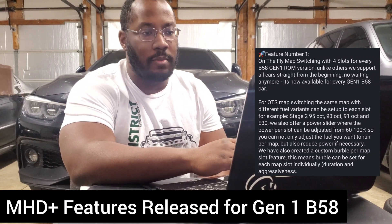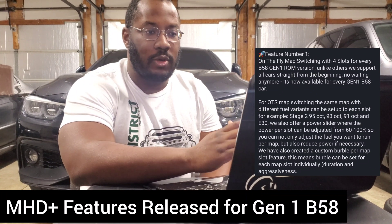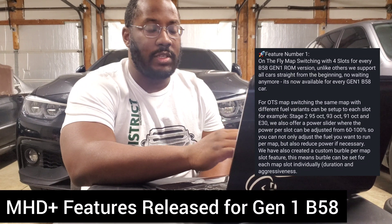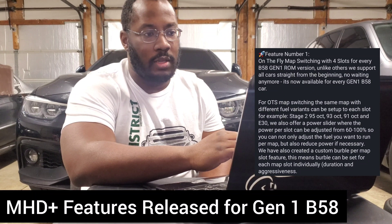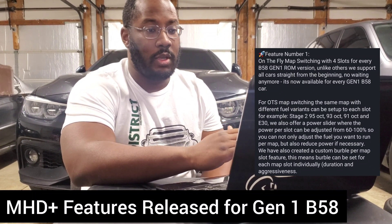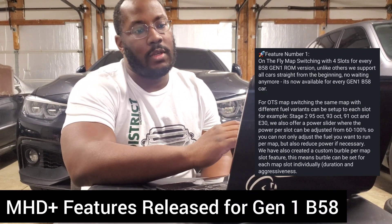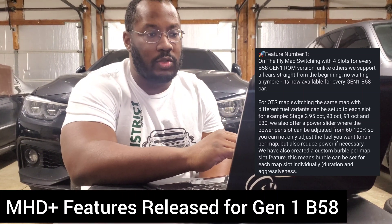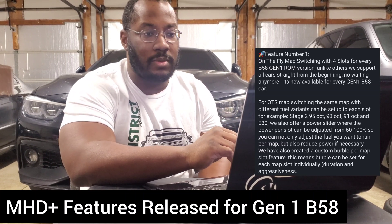There might be other reasons as well, but it's probably not going to change anytime soon. They have Stage 1 and Stage 2 multi-maps as well as custom enabled. They are not releasing a multi-map option for the Stage 2 high pressure fuel pump maps yet — they're still updating those calibrations because they feel there's a really big difference between the 102 RON tune and the E30 or E40 maps. They're going to do more work on that just to make sure it's a clean switch between those two. But right now we do have at least some capabilities for map switching.